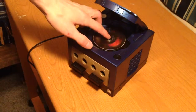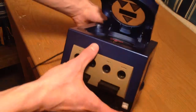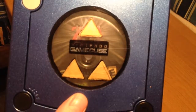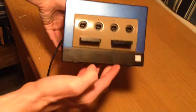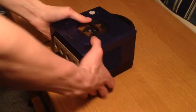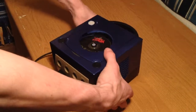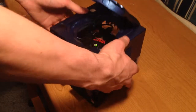When you look at it, you've got the disk in there and this is a really nice metallic blue inside. There's the window so you can see the disk spin — it's really cool. And then the tan on the front with a satiny shine. To get your GameCube open, flip it upside down and take out those four screws in the bottom corners. Then open up the disk drive and the whole cover just slides right off.